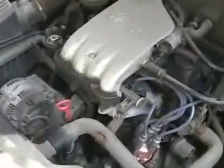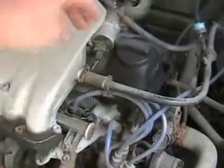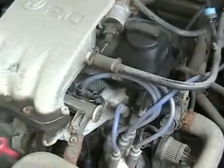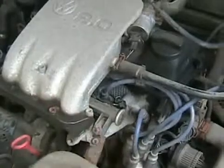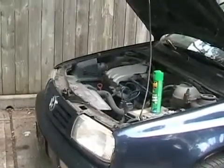Well, compressed air in a pressure wave is good for an engine. That means when the valve is closed waiting for the next charge during high RPMs, a pocket of air has already moved, piled itself up against the closed intake valve, and then when the intake valve opens, the air has its own dynamics of motion and wants to push itself in, almost like it's a little bit supercharged or pressurized. That's good for performance.